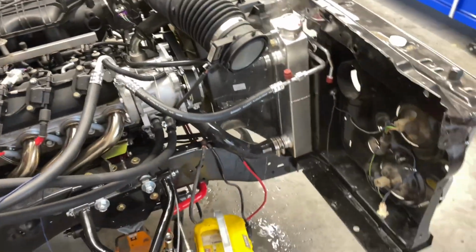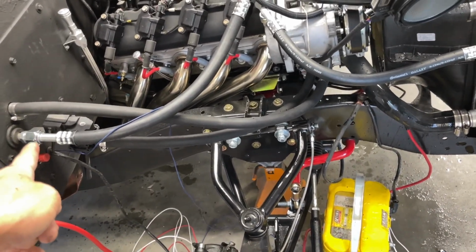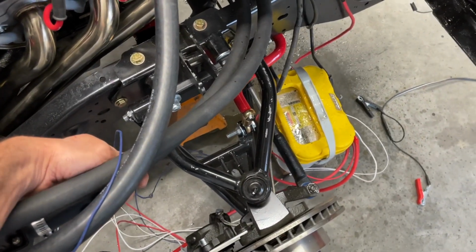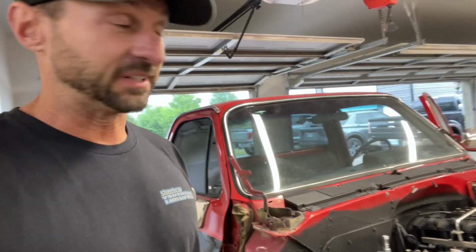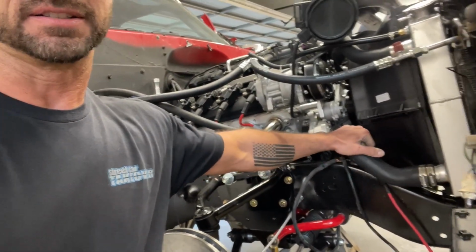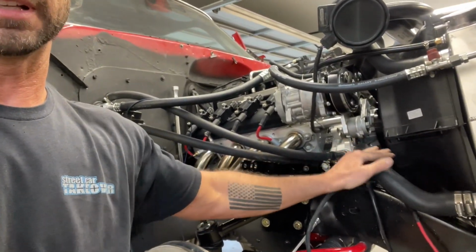And there's absolutely no hot water coming out of this heater core. So it's not circulating either. So it would seem our water pump is not pumping. I had a little heat in the upper coolant hose. I had absolutely none down here. It was still cold. Now close to the water pump is a little warm, but I just think that's heat